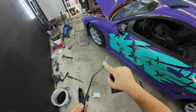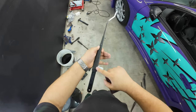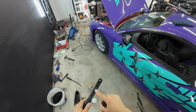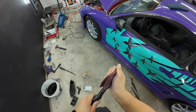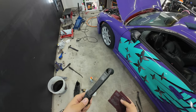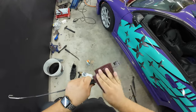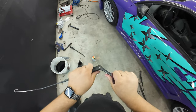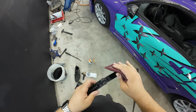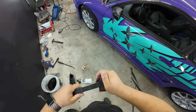Basically I'm just roughing the surface a little bit. As you can see, this was actually the way it was when I got the car — it was just kind of this fadedness here, then it went to regular black. The shininess you see down here is the PB Blaster because this joker was seized to that spindle. I might not have wipers after this because I was just hammering the crap out of it and it finally let loose. So we give it a little scrub, rough up the surface. Don't be afraid to bend this, getting into the creases and grooves. Just get it all nice and flat — nothing shiny.